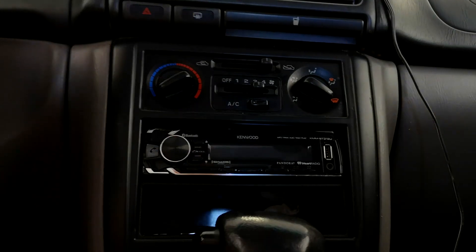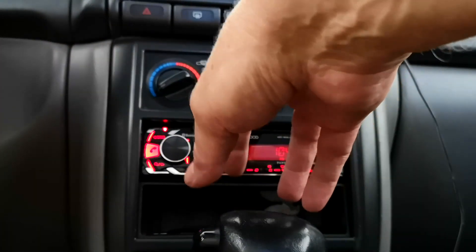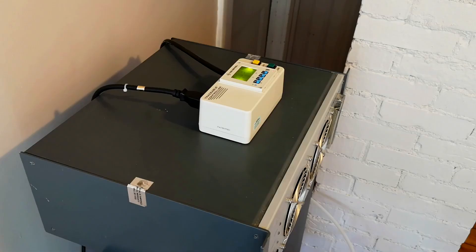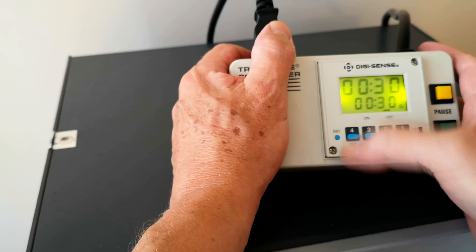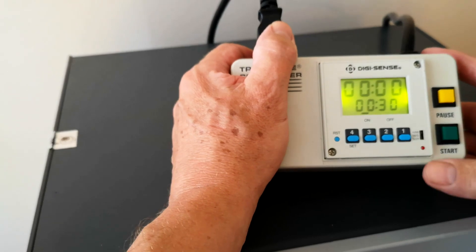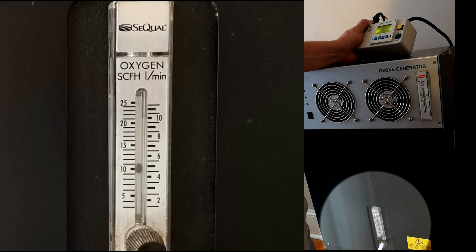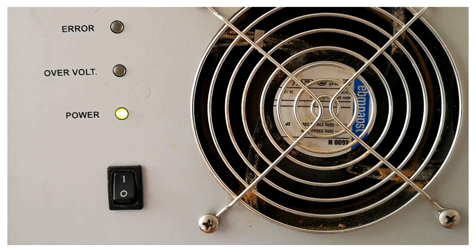When you're ready to ozonate the vehicle, you turn on the interior ventilation system. Then you stick the ozone delivery tube into the window. After that you dose the ozone — you take the controller and enter in how much ozone you want. In this case we're putting in 30 seconds of ozone. Once you push start, you'll hear the oxygen concentrator start up, you'll see the air flow meter on the oxygen concentrator rise, and the same thing on the ozone generator — you'll see the airflow meter come up and the ozone generator will start buzzing and it's generating ozone.